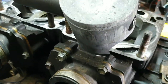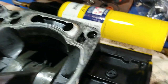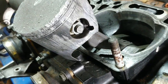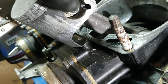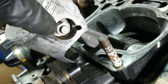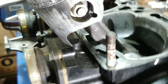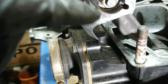What's on either side of these pins - and this is the pin that's in there - what I'm trying to get out are what's called circlips. The circlips are these right here and they just go into a little groove on the inside. That space should be at the bottom or at the top. You don't want it sideways because over time it'll compress that spring and come out, so you want it up or down.